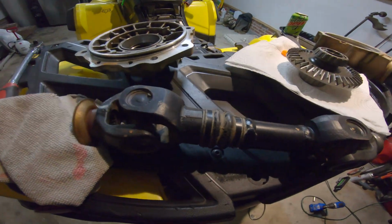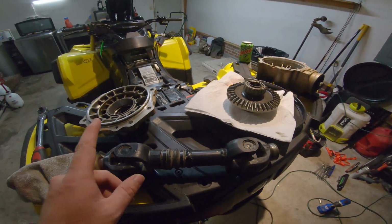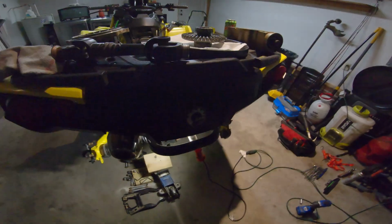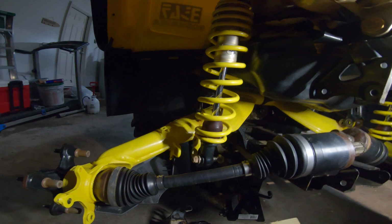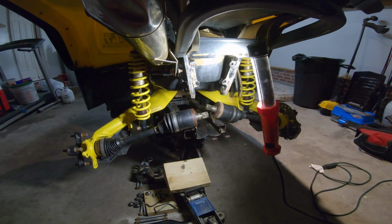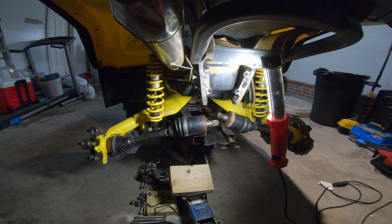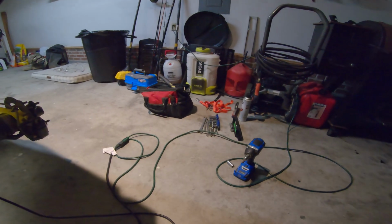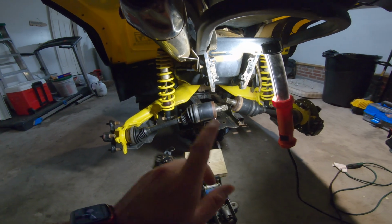So the next video, as you can imagine, I put a post on Instagram and it looks like everybody wanted to see a video of us rebuilding the diff since there's not many online. I did not get any clips of me pulling it out, but you will see me putting it back in. Super easy. As you see, I did not take the trailing arms off. A lot of people say you have to. That's a lie. It's super easy to get the axles out without taking the trailing arms off. There's quite a few methods you can use to do that. The method I used works super easy. It's literally just a strap and wrench, but I will show you more about that in the next video, so make sure you guys stay tuned for that.